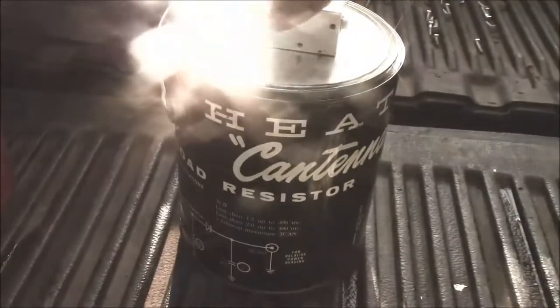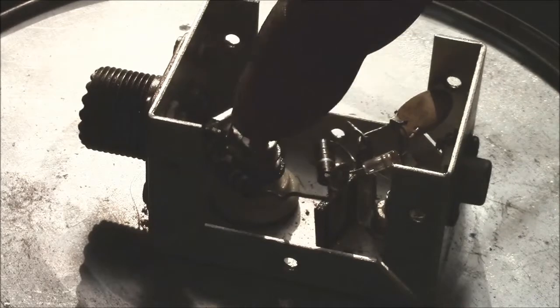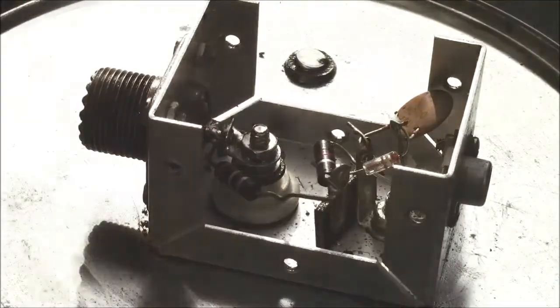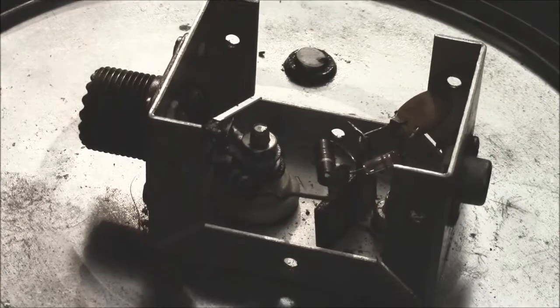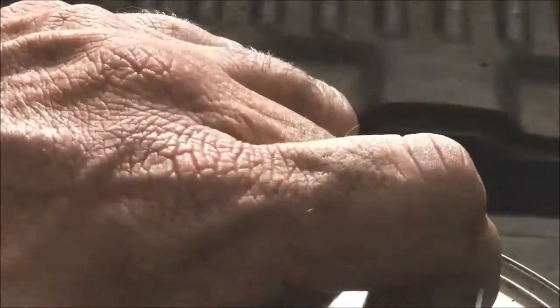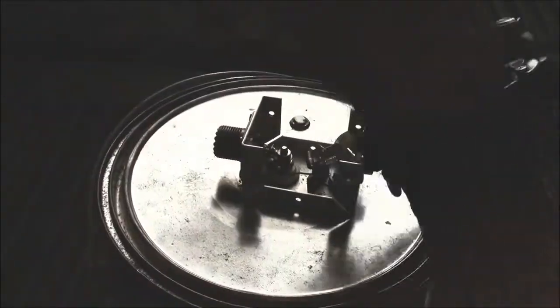One of the things I like to do on these is — where this goes on top — there's a little insulator right there. Before I assemble them, I put a little dab of RTV around the top and the bottom of that to help seal it up. Put a dab of RTV on the screws — on the heads of the screws and under this little chassis. It'll seal that up. When you're carrying these, it has a tendency to slosh up underneath and wick the fluid up in there. When you're going to put the lid back on, just heel your hand around, back and forth, or use a little rubber hammer.